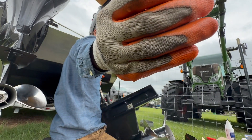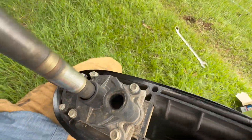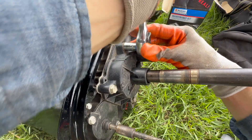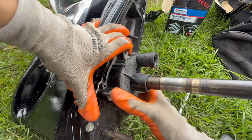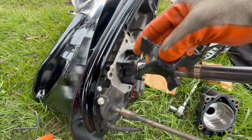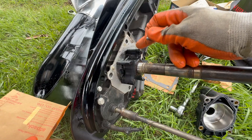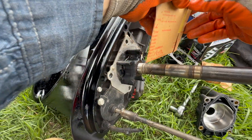There's a little clip on the shaft — stick that back up into the housing. Our water pump is right inside this box, held in by four bolts. Remove those — they won't be super tight, so when you put it back don't crank them, just snug. Grab the housing and wiggle it off, then slide it all the way off. From the maintenance kit you get the new water pump impeller, a gasket, a little key for the impeller — make sure you keep track of that small part — and a new metal plate and gasket to seal it back up.